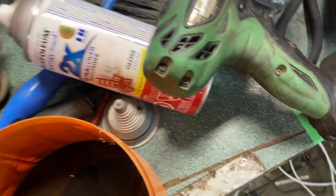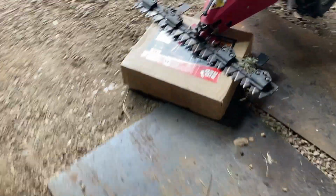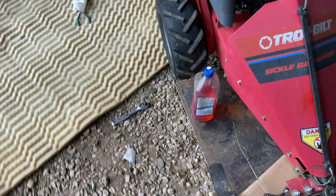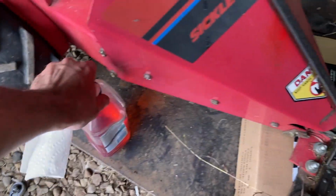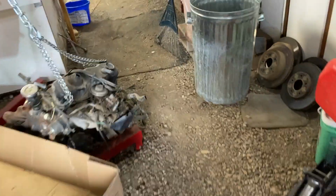And I just got the rest of the gas out. I don't know how old it is, and I can't tell because it's farmer gas, which means it's been dyed. Means whoever put fuel in this was paying less taxes on it than most people. So it's actually dyed red so that it's not used in on-road vehicles. It's only used in farm equipment. So, but I don't know if it's ambered because it's old. It smells okay, but yeah, we'll put fresh stuff in.